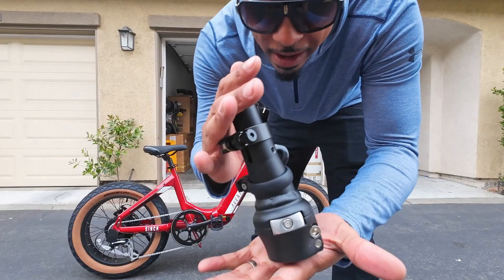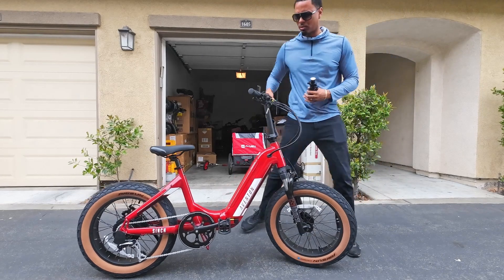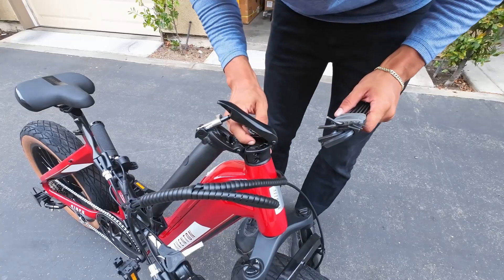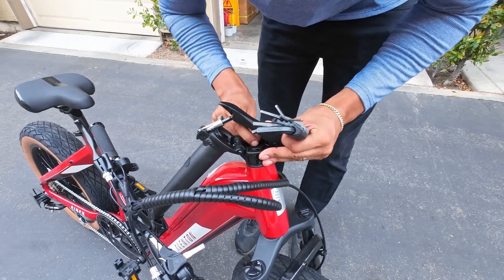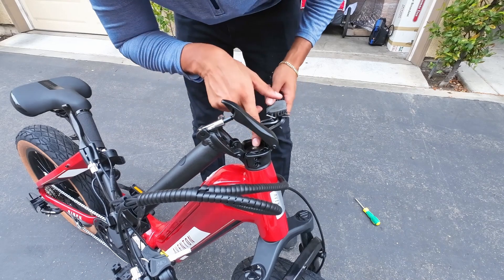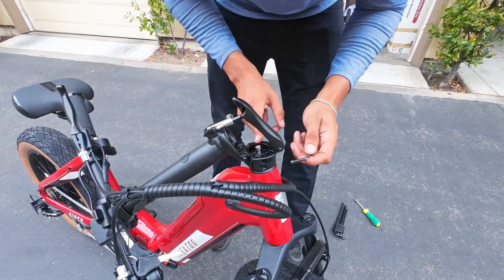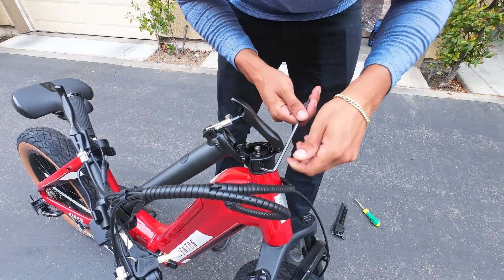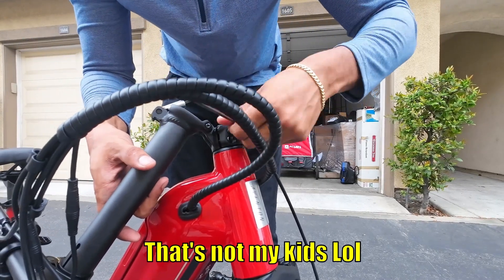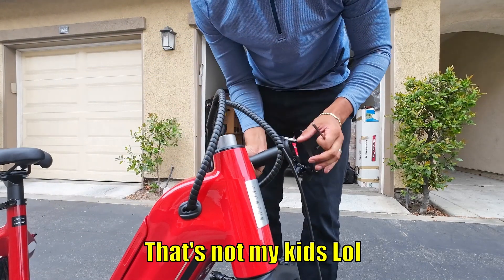All right, so here's the Turtleneck FX right here — brand spanking new. It's super easy. The first thing we've got to do is take off this giraffe neck stem. Once you fold down your bars, you want to remove this top cap right there — it's just a little cover that you need to pop off. Then get an allen wrench and completely remove this bolt right here. Once that's loosened, loosen these bolts on the side — you don't have to remove them, just loosen them. Once those bolts are loose, you can slide the giraffe neck stem off the steer tube and set that to the side.